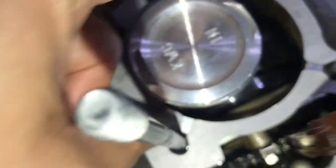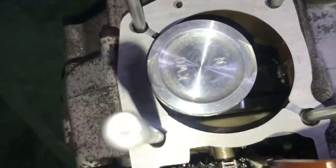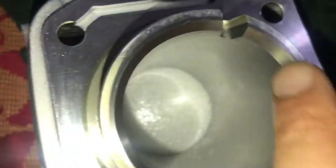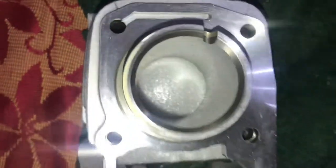Another little note: I put the little pins on the side using a pair of small pliers — not too tricky. It moves nice and freely, which is good. There is a little bit of side-to-side play but I'm not worried about that because it'll be taken up when I put the piston in. Traditionally I've always used piston ring compressing tools to install the piston, but if you look here there's a little lip at the bottom — I believe that's to aid installing the piston, so you can just literally press it over. I'll oil this just a little bit to make it easy, and oil the cylinder with some engine oil.